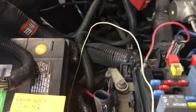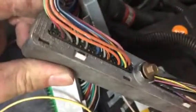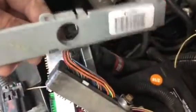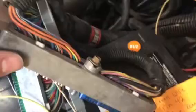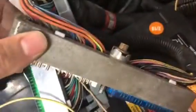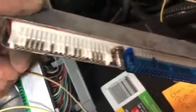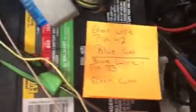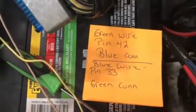You're going to take your two wires, and if you un-pin these with the other connector out of the ECM, like I said, it'd be completely plug and play. Anyway, you're going to need to go to your connector and take off the gray caps back here — they can be kind of a pain; you might stab yourself trying to get them out. You'll take the gray cap off. You also need to take the blue lock and the green lock out from the corresponding side, and here are the wires you're going to need to put in or stab in.